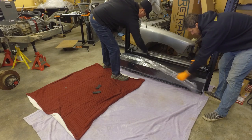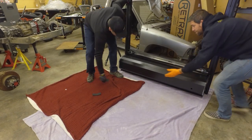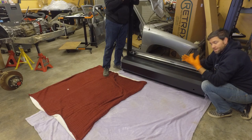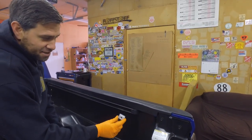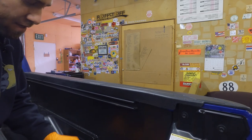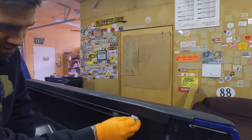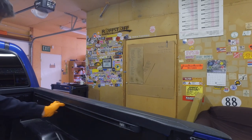One of the next steps is adding foam pieces to the bottom. Pull off the clean plastic pieces to access that area. This step is primarily for five-foot beds because the wheel wells are all the way back and you don't want any vibration or rubbing. Now slide the mounting clips into the rail — pull out the black plug by pushing in on it and it comes right out. Make sure the concave section is towards the back so you slide over the bolts holding the rail in place. Stick it in and slide it in — you're going two per side. Leave one here and slide the other all the way to the back side.